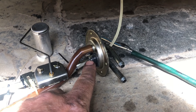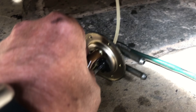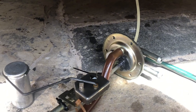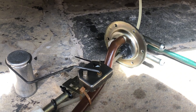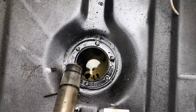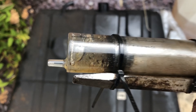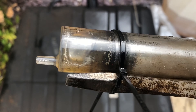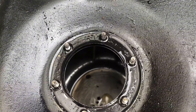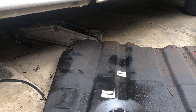Regarding the pesky fuel pipe, I've decided to put it back together with JB Weld. I cleaned everything, put a washer on top, scratched everything up to a high sheen, and I'm going to hope for the best. There's also a zip tie on the base covered in JB Weld just to get a bit more adhesive in there. I've spent quite a bit of time in here fishing with a syringe lashed to a screwdriver to try and get the deposits out — when they come out they go straight into this funnel with a bit of kitchen roll to filter the diesel. Hopefully you can see the dirt in the diesel. I don't think we'll ever get all the sediment out but we've yielded a good improvement.